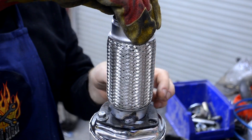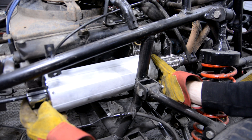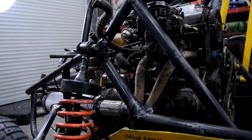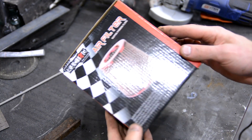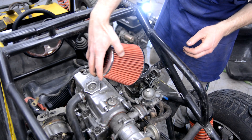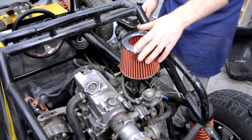I'll keep the same muffler from the buggy but with an internal pipe modification to match the 50-millimeter dimension. During fitting I put everything together on tacks, then welded it all and finally installed the muffler in its place. For the air filter I used a zero-resistance filter — the only option since another type won't fit due to the carburetor being close to the frame. I saturated it with special liquid and installed it on the carburetor — it fitted perfectly.